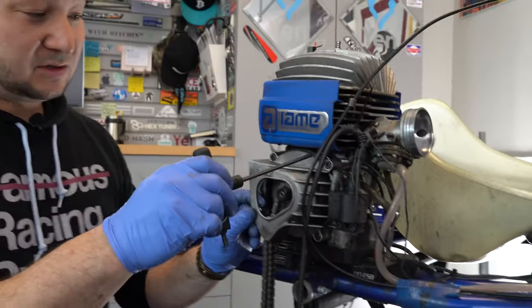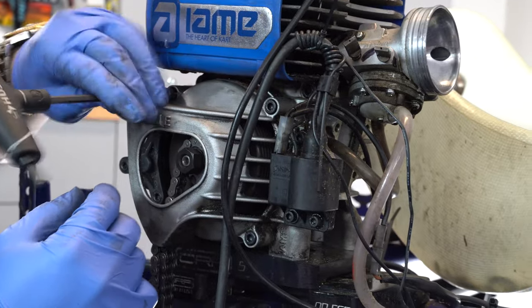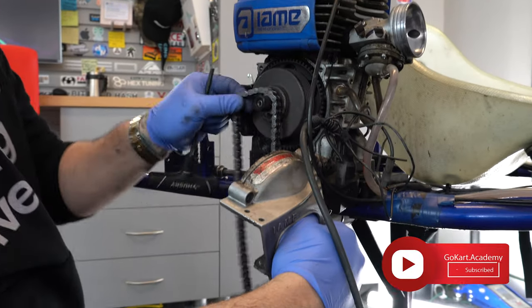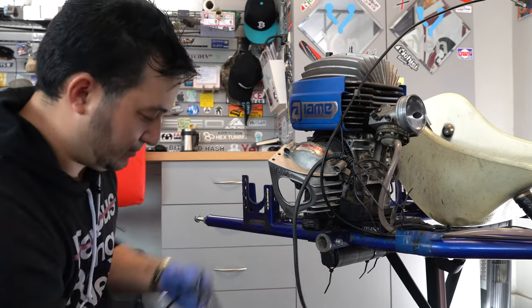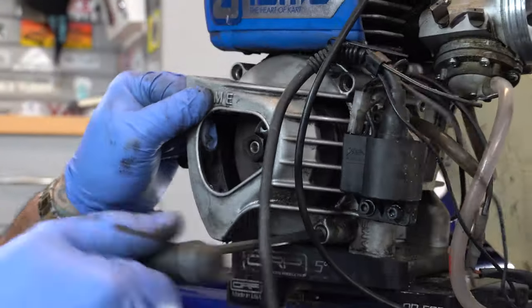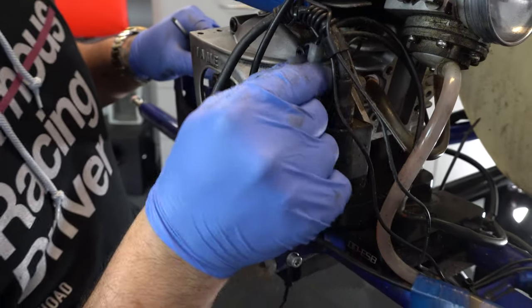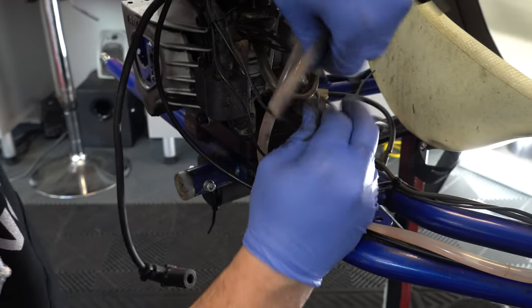On this Mini Swift there are three bolts covering the clutch group — use a 5mm, break those loose, and slide them off. As that drops down, we'll pull it away and remove the chain. Set all of this to the side for safe keeping. Later when we do a deep clean on the engine, we won't have to break these bolts off again, so we'll just lightly thread them back into place. Next, remove the connector cable from the stator to the coil, as well as the other connector to the stator and wiring.